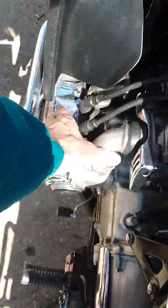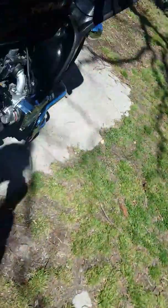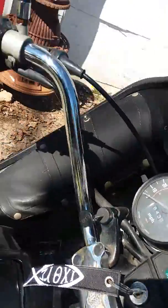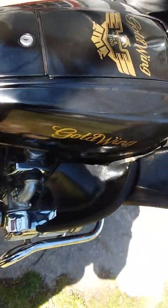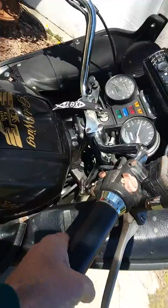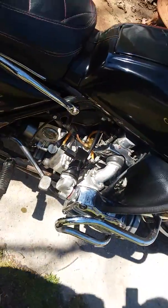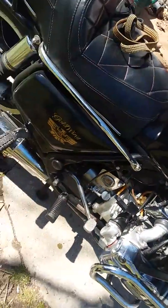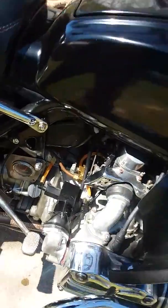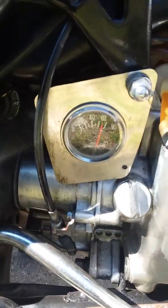It's pretty cold. I've got the choke all the way on and I've got the idle turned down. There's a little tab you can bend to make it idle down. With the choke on, it's got super oil pressure right now — that pressure will go down once it warms up.